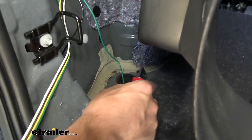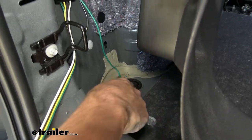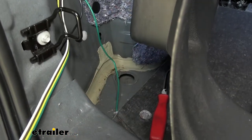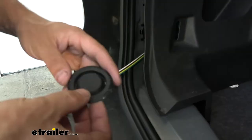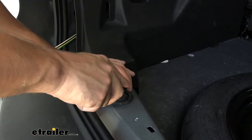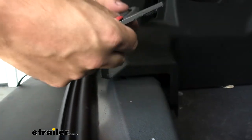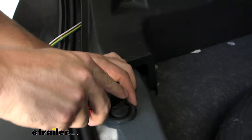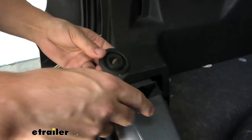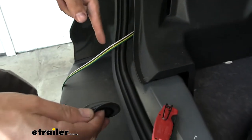On the driver's side, we're going to come back and look on the floor for this grommet here. It's pretty easy to identify. We're going to take our trim panel tool and pry it out — whether you get it out the front or it pops out the bottom, either way we need to remove it. Once we have this grommet, we're going to take a razor knife or scissors and cut a nice large slit in it. The reason we're doing that is we're going to sneak our power wire down through that hole so we can route it underneath the vehicle and up to the battery.